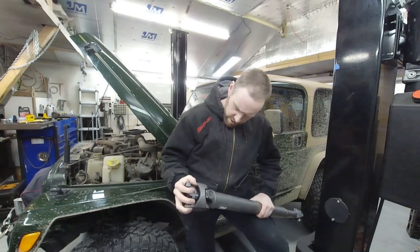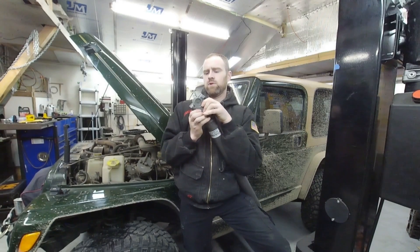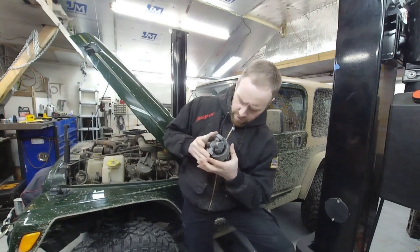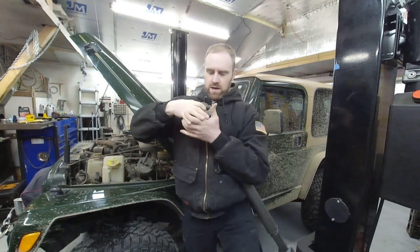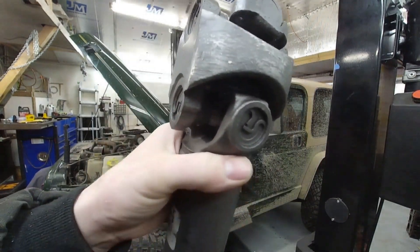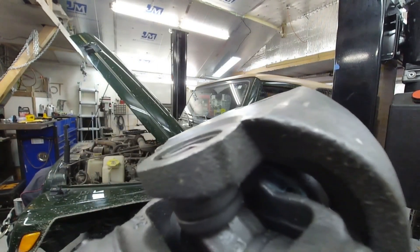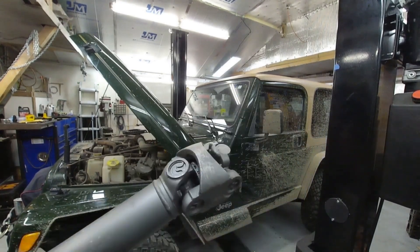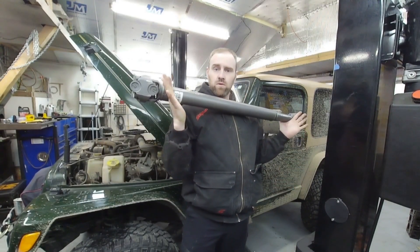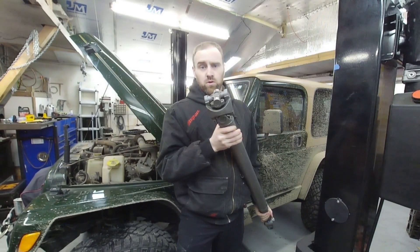Where it fails — check this out. See how when I move this block, this joint will actually move with it. What we have is a little ball socket inside of here. You can see that little joint inside of there where there's a little bit of grease sticking out, and you can see some of the grease oozing out of the side. That little ball socket inside is the part that's prone to failing. We're going to pull the old one out and show you what we're up against with these things.